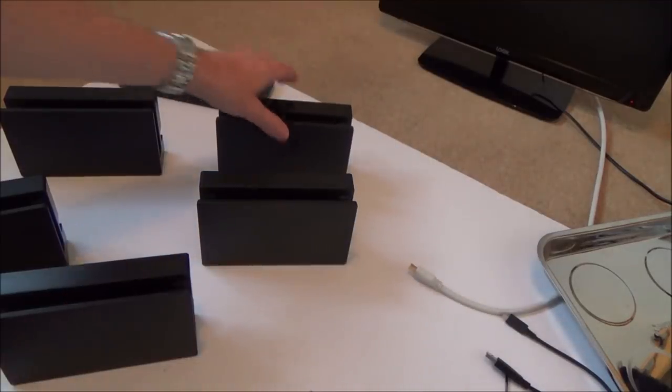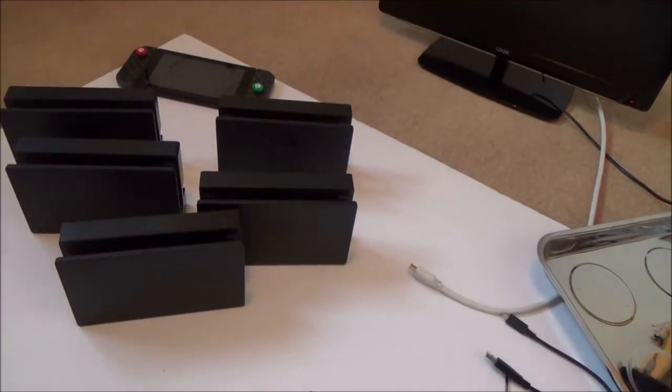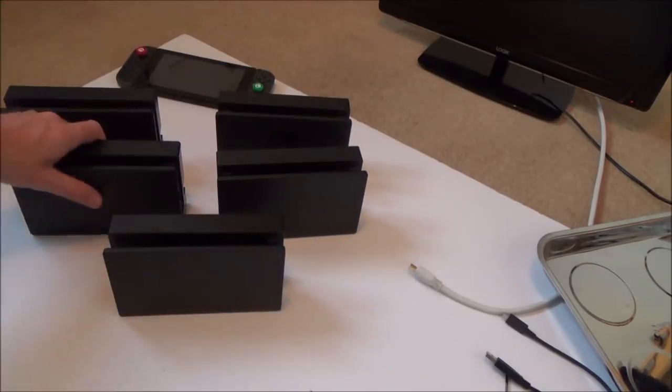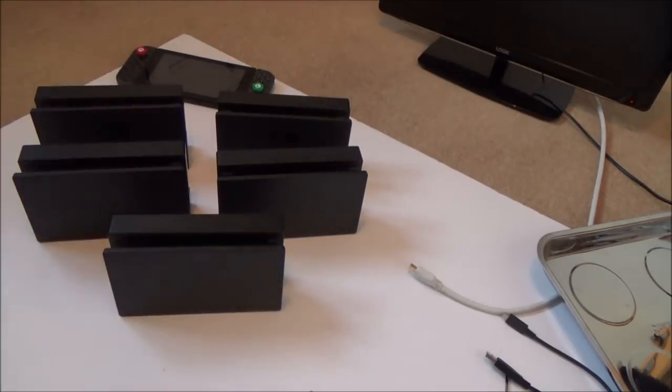So there we go. That was a really good one, because it was just so easy. It was nice, actually, that one was faulty. I kind of wish that I had seen a fault with the ribbon cable, for example, like a bit of corrosion or something that I could have cleaned up and then got it working. But you've seen it wasn't working. You've seen when I swapped out the motherboard that it started to work on the other one. And then you've seen that when I put the good motherboard in that one, it didn't work. And then you've seen when I swapped the ports, it did work, and so on. So it was pinpointed to the ribbon cable.